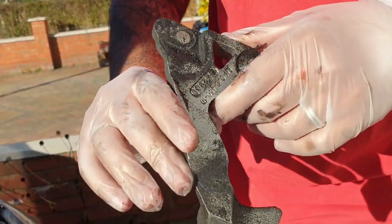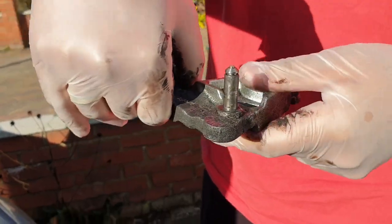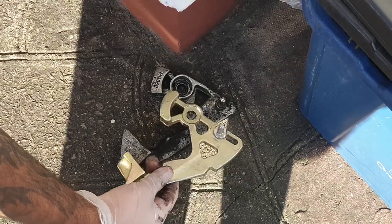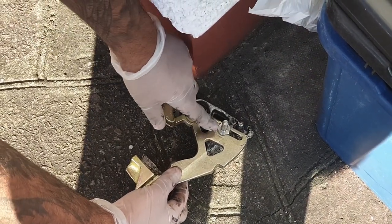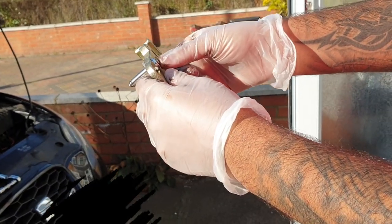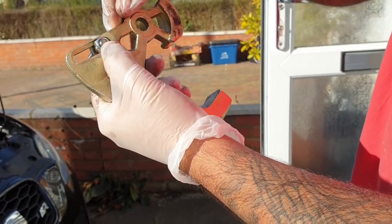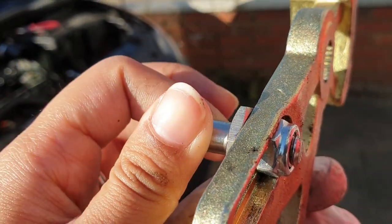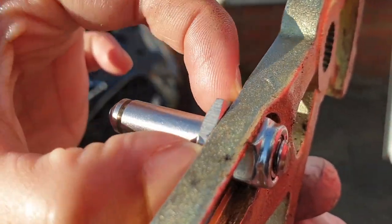You can see the state of it — this pin isn't removable, it's the factory one. There's loads of grease in there which is where it actually slides along. On your new one, install it similar — put them next to each other. You can see it's wider there, but the distance between this and that is actually shorter. On the new one it's going to sit in the same position. There's a bolt with a nylon nut on the other end — it's a bit awkward; you have to put the nut in because you can't twist it. Use a spanner to tighten that.